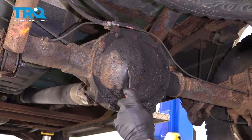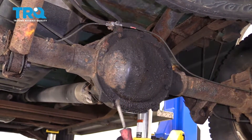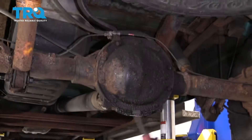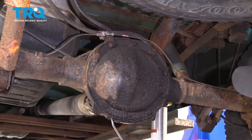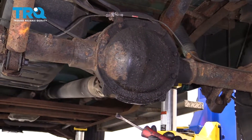It's gonna be time to drop your rear differential cover. Make sure that you have your hand protection and eye protection still. You're gonna wanna catch a bucket because inside here there's gonna be a lot of gear oil — it needs to go somewhere, preferably a collection bucket. Before we drop it, go ahead and clean down the areas, especially where the pan's gonna mate onto the rear differential, because the last thing you want is any crud getting inside there.